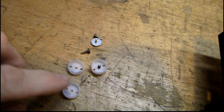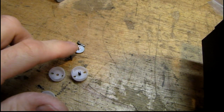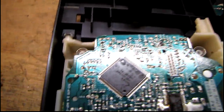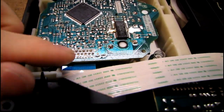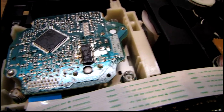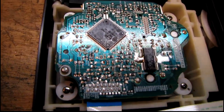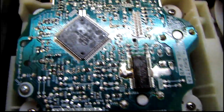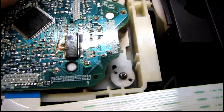There's a small spring that sits on each post, and then after that you put the screws in. An interesting note: there are only three plastic caps that cover the springs — the fourth one only has a washer on the screw, and that's it, on the back corner. I'm not sure why they did it differently. Don't forget to plug in the ribbon cable, make sure it's not folded and is exactly the way it was before, then go ahead and put the screws in. All screws are installed and you can see that one corner doesn't use the plastic spring retainer.